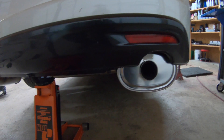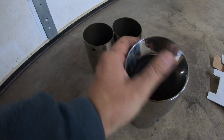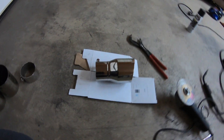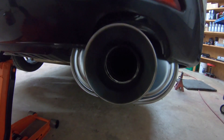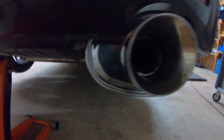I went ahead and put the muffler back on the car and cut the tip off. These are the two tips I cut off the old mufflers, and this is the new tip going on the car. We're going to cut this one right on the edge, put it against the muffler, and weld it on the inside for a nice clean weld — nothing on the outside. We're going to have the tip inside, nice and centered, and weld it to that. Then paint the outside of the muffler, just leaving the chrome face.